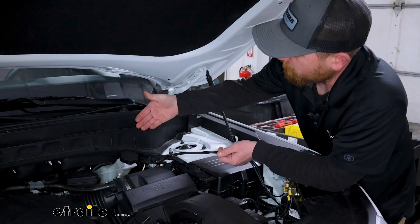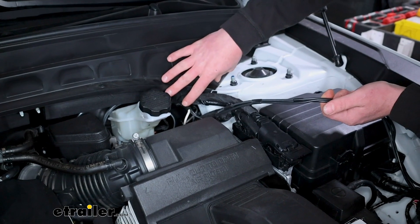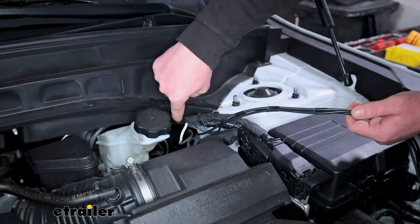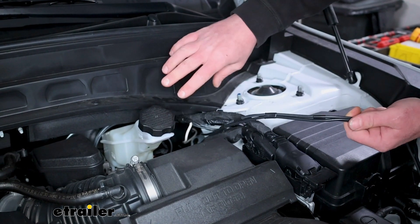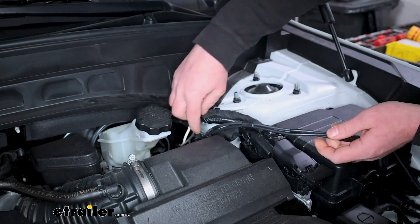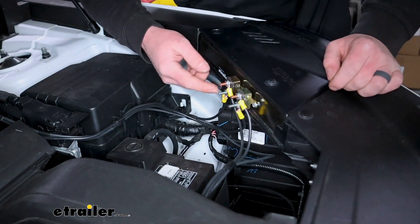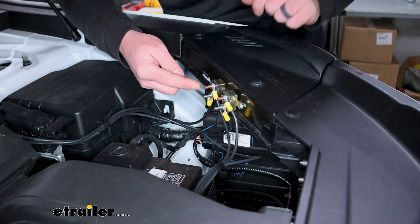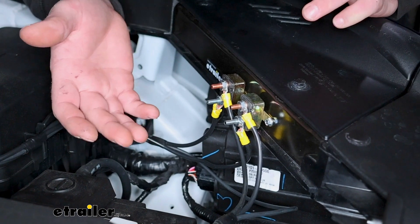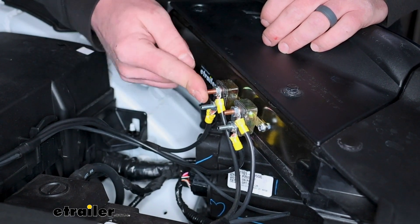Up in the engine compartment, this is where our wiring came up. Right here I completely removed the rest of the gray sheathing to get it out of the way. The white wire is going to run inside of our vehicle down on the driver's floorboard — we'll get to that in a minute. What we'll focus on first is the black wire coming from our duplex wiring, which is going to run over here where we have our breakers mounted up. There's a 40-amp breaker and in our case a 20-amp breaker — that'll be the case for most of you as well. Check your brake controller instructions to see what they recommend; a lot of times it'll be 20-amp.